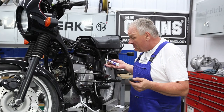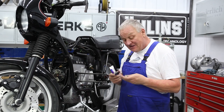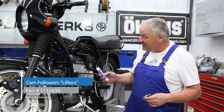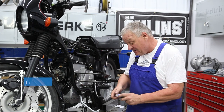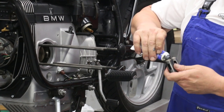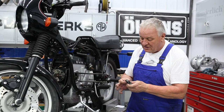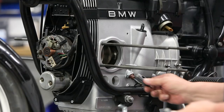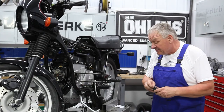When we took this motor apart we found that the lifters were all pitted and needed replacement, so I've got some brand new lifters here. I'm going to start by putting those in and put a little bit of assembly lube from Liqui-Moly on here. The LM48 works really well — a little bit goes a long way. Put it on the sides and on the face, then just put those in. And on the other side as well.